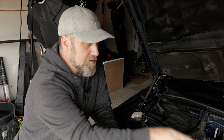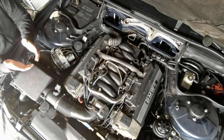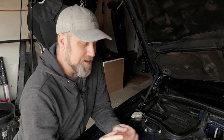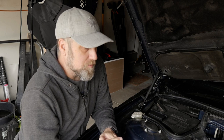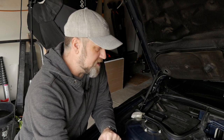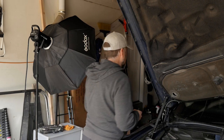We're also going to pull everything off the power steering system — it's leaking and I don't know how old the reservoir is. Taking care of power steering and coolant should fix two major leaks. I think it's coming out of the back, which is a pretty common problem with these. First things first, we'll take off all the air intake stuff and start attacking the top of the engine. I need to start the car, pull the fuel fuse to relieve fuel pressure, then disconnect the battery before messing with any electronics.